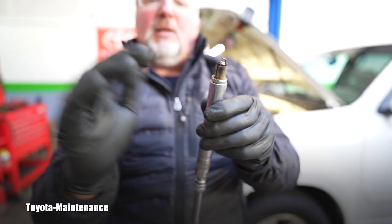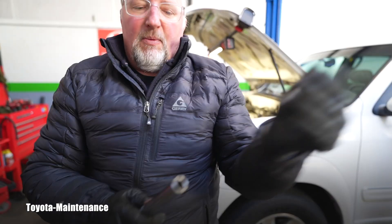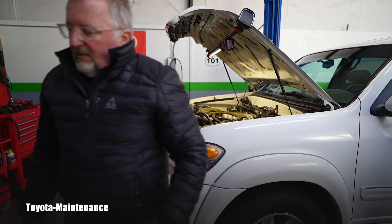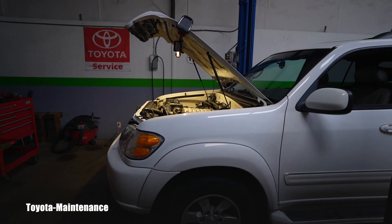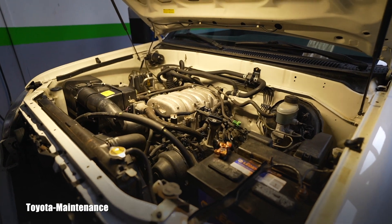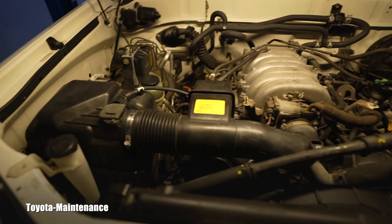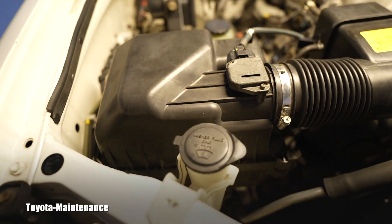All of them — basically the tips are burnt off. It's the tip which is on the spark plug, not the hook, but the tip coming out the front — the backs are burnt off. It's perfectly visible across all eight spark plugs.